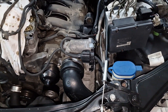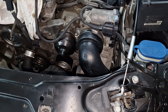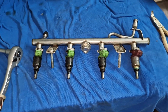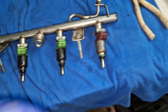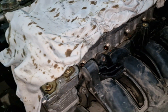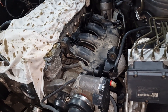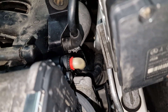With that done, the next step is removing the intake manifold, and then I can remove the compressor and reach it from below. It's a lot of work to do but it's worth it. The next thing to remove is the injector rail — basically you have these two screws, you unscrew them, then get pliers and catch the throat of each injector and pull it up. Wiggle it a few times and everything will be exposed. Now I just have to remove the intake, which is relatively simple.